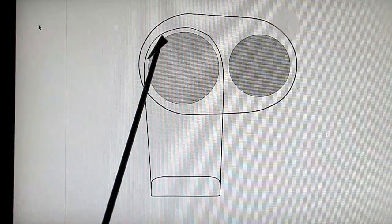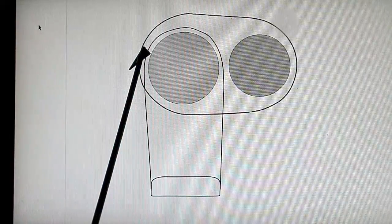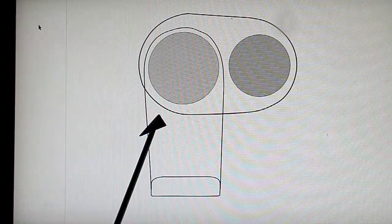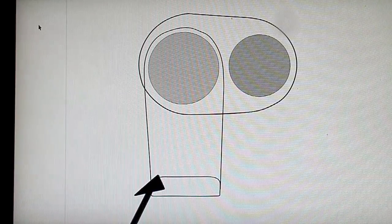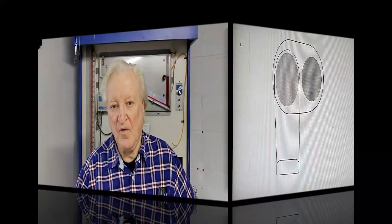It would appear to me that we can get more air out of here, because the valve is slightly shrouded here, so cutting this away in some sensible form will do that. Whether we'll recover all of the swirl still remains to be seen, but we will pick up some. We need to find all that we can here. That about wraps up what we've got for the intake port on what essentially could be our stage one head — it kind of depends on what Richard wants to do next. Our next video on this will be how to do the combustion chambers on a head where shrouding is present and we want to minimize that shrouding.